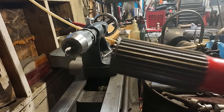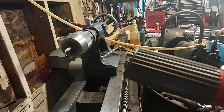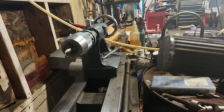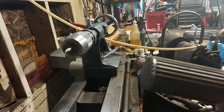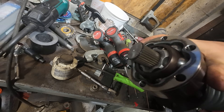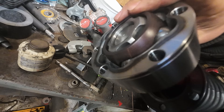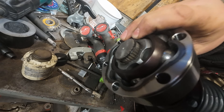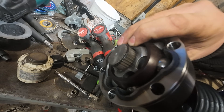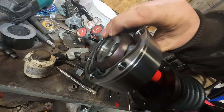I got the shafts hacked off, put another center in them, tested a spiral lock clip — all good — and we hit our length target spot on. Here's a demonstration of how a counter-bored star works: you can see how it allows the clip to pull clean into the joint. That extra quarter inch per side should help us and at least add a margin of safety.